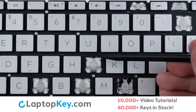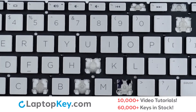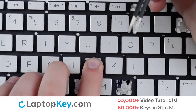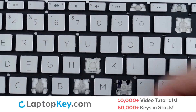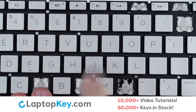Then, using the metal hooks, we will lay the clip down bottom first. Push upward and down slightly on each of the corners until it is in place. Put the keycap back on top, firm press, and we're functional.